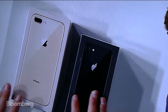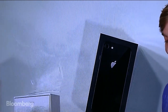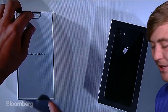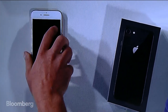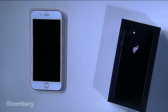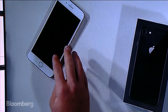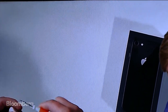We're going to be unboxing both phones and taking off the screens, checking out the insides. Part of what we're really excited about with these new models is wireless charging, and we're going to be looking at the components that allow wireless charging as well as fast charging, which is supposed to be up to 50% faster. To start, we actually have to remove two bottom screws — they're called pentalobe screws, and we use a specialized screwdriver.